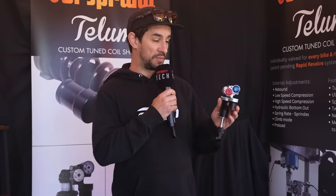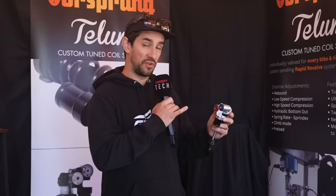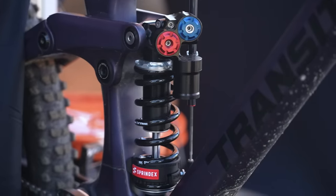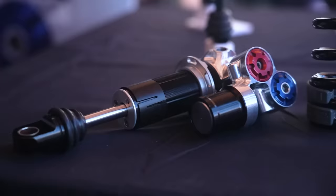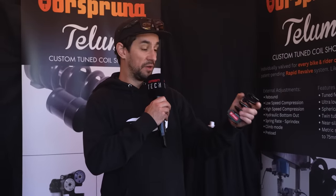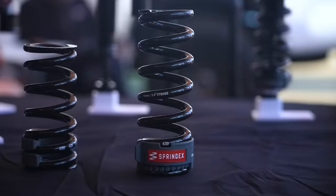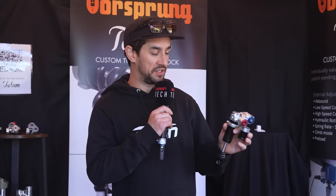We don't see many people producing their own shocks, but Vorsprung have. This is made in Canada - their brand new rear shock. Loads of cool features: high and low speed compression control, rebound, and hydraulic bottom out. There's options with a spherical eye on there as well, so any flex in the frame as you're hitting corners doesn't add friction into the shock. Twin tube design on there as well. They've got a really in-depth setup guide on their website - you put in your details and the bike you're riding and it'll give you a good idea of how to set that shock up. It also comes with a Sprindex coil as standard. With a coil shock you buy the spring rate for your bike but can't adjust it - Sprindex gives you a 10% range to make it a bit harder or softer, so you don't need to buy a new coil every time. They also have a rapid revalve system so you can completely change the shock internals easily. Available in metric sizes on the stroke from 50 up to 75 millimeters.